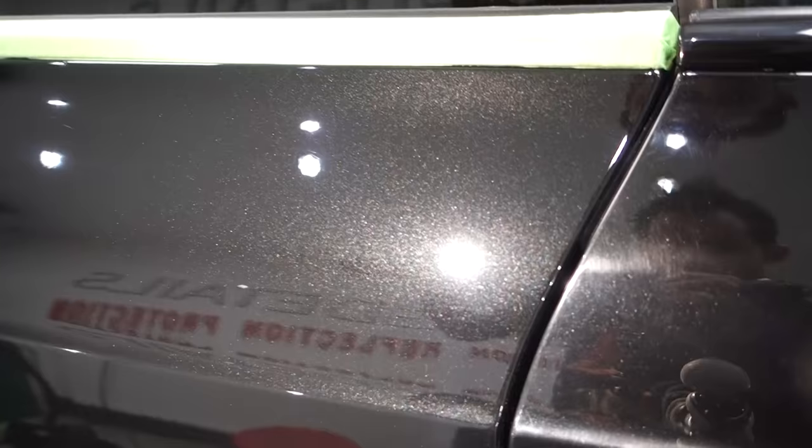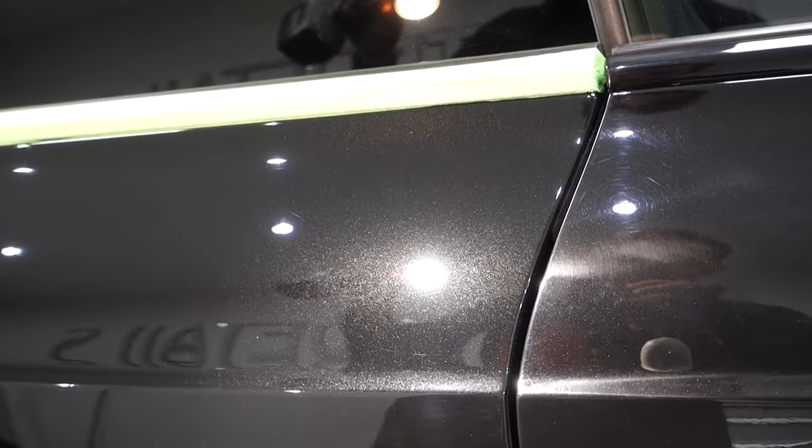So, to give you an idea now, this hopefully is how the rest of the vehicle will come out. You can see a much more metallic, sharper finish. There are scratches remaining. This could very much be a major correction. However, given timescales, the budget requirements, the customer's requirements and priorities, localized corrections are being made to the worst areas, but this is under the intense light. So these marks, outside in normal daylight or sunlight, you would do well really to see them.